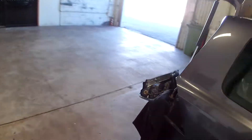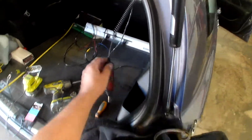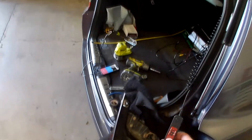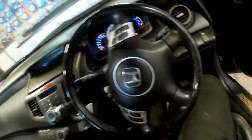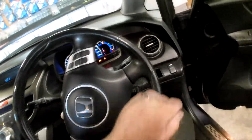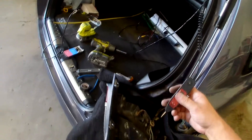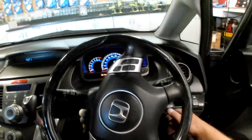Now if we come to the back of the car again, we can see my reverse light is on and on that same wire I now have voltage. Just to confirm, we'll pop it out of reverse and into neutral. I can see the reverse light is out — I'll retest it — nothing. So that is a really good indication that this particular wire, in this case green with the black stripe, is the reverse trigger.